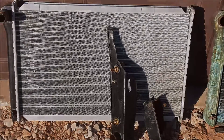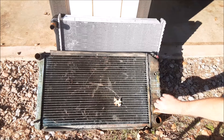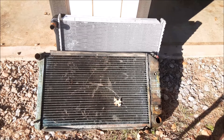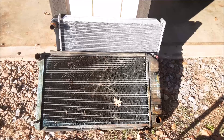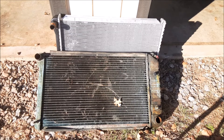Let's go ahead and get that OE style radiator in. I happened upon this fitting in one of my bins and it fits — it's inverted flare to 6AN. Here's another 5/8 inverted flare to 6AN. So I can put those in there and get her back on the road.